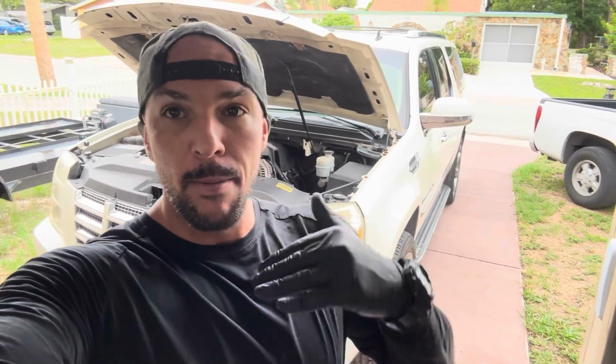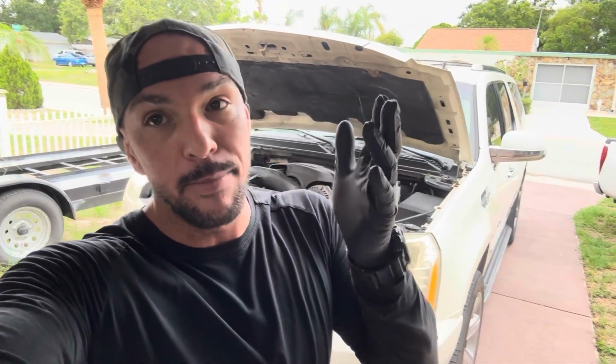And it was continuing to throw bank 2, sensor 1, sensor 2 O2 sensor codes, heater circuit codes primarily. And I thought it was very strange because it would come up as pending, kind of go away, and then come back again. And I'm like, okay, I'll swap the sensors out. Swap both sensors out, cleared the codes. It comes back almost immediately. And I'm like, okay, it's unlikely, Powerball odds, that I would put in 2 new sensors, even if they were China sensors, that were bad in this thing.